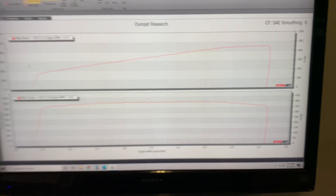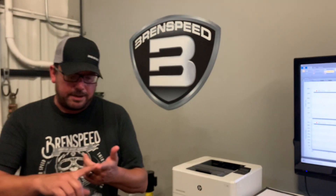Makes for an absolutely fun ride. So if you have a GT or an 05 to 10 with an M90 on it, our 490R upgrade is a really good package. You can add the cams and the headers. It's a really easy way to make this kind of rear wheel horsepower off pump gas and have a lot more power. And basically that's about the limit of the M90 — it's a very small supercharger. It sounds cool, I love the way it sounds, but next is when you'd want something like a TVS. So you'd want to go to a bigger supercharger if you're looking for power beyond that.